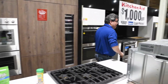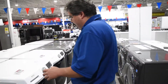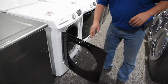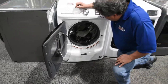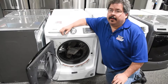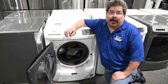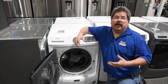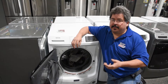We're going to go over here and take a look to show you what's going on. For a washer, brand is irrelevant — this is technology. A front load washer is a sealed unit. What I mean by sealed unit is this fills up with water, so it has to make a hard seal, which means no air gets in or out. If you have no air getting in or out, you have no chance for the house air to dry the water.